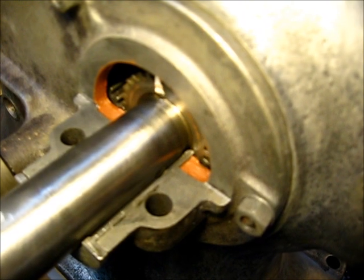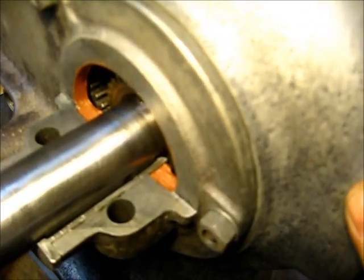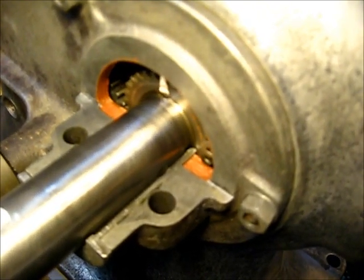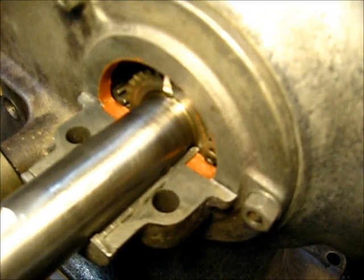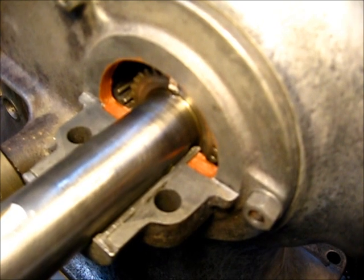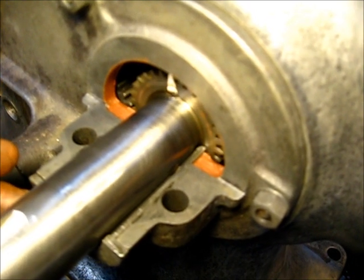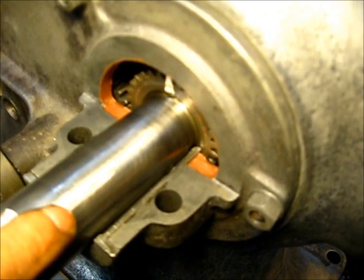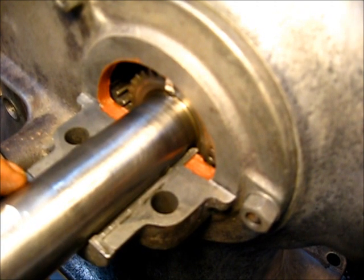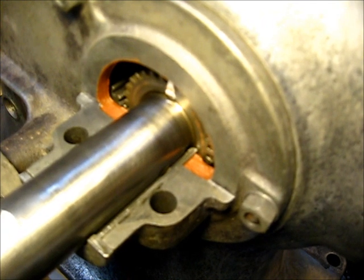The best rule of thumb I've found is once you get all the shims and everything bolted together, you can still slide the crankshaft back and forth — even after you get the piston in there. When you put your flywheels on, that is the time to center it up. Push it as far as it will go one way, make a mark, pull it back the other way, make a mark, and slide it back half that distance. That's where you lock your flywheels in, centering the gear and putting your rod in the center of the engine.